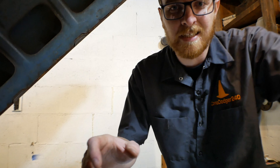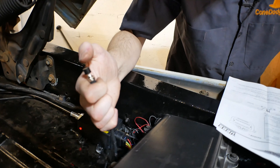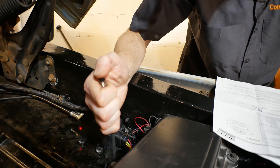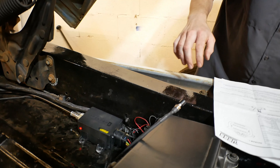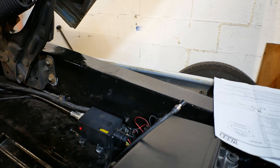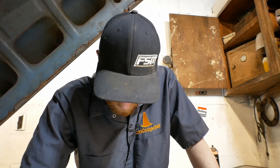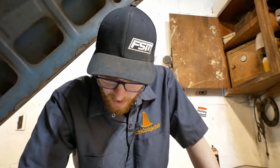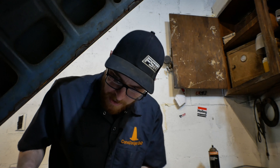We have light — a flashing light on here, which I assume means it's acquiring signal or attempting to. Press and release — it's not going. There's no way it's that quiet. For the sake of not driving myself crazy while I'm figuring this out, let's pull the fuel pump fuse. While the speedometer is connected to the speed box, turn the power on, press and release the included setup button — the speed box will ramp to what 60 miles an hour should be. I have to disagree with that.